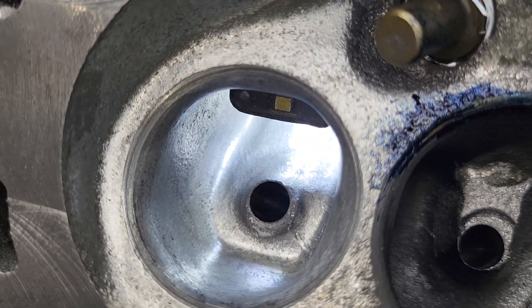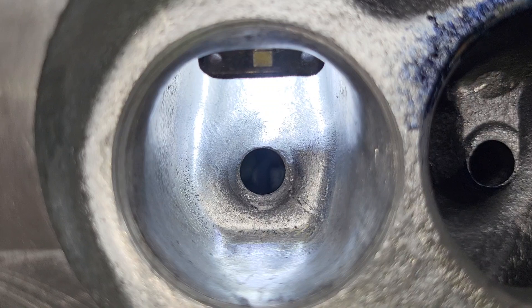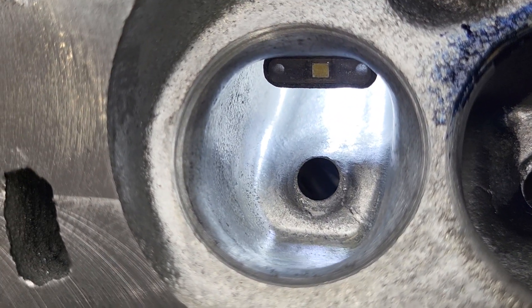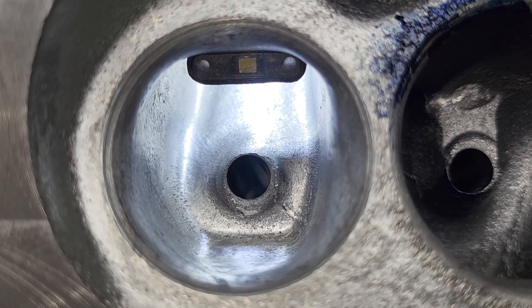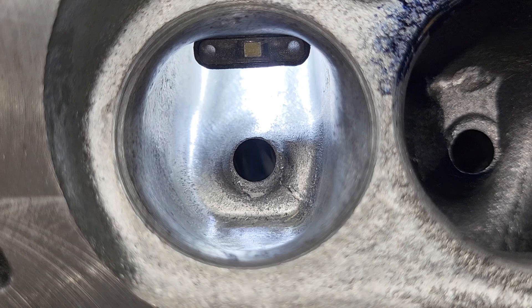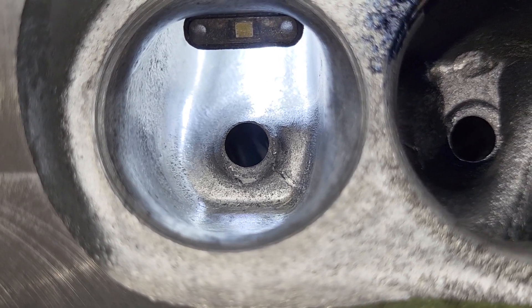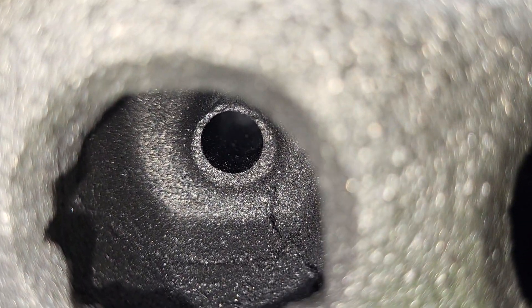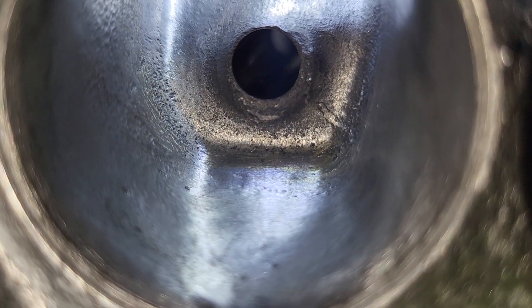This port will get a polished surface on it. As you can tell, it's basically cleaned. It's a first cut — you don't want to go overboard. You want to clean it up, make it look decent, and see where you are as far as your airspeeds, then move on from that point. That's how I do it. While I was doing it — can you see that paste ooze line at the back of that bowl? I was just able to get that out without making it too thin. Let's take a look at how thick that is — that's where we are. It's about as thin as I'd like to make it.